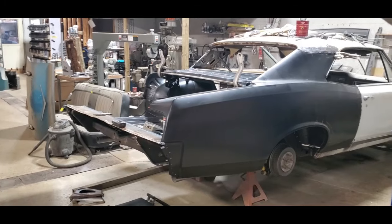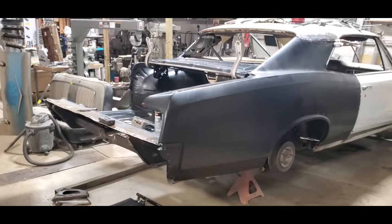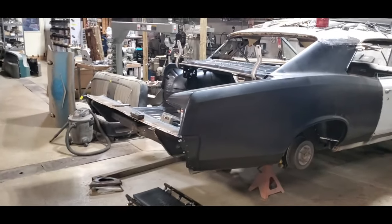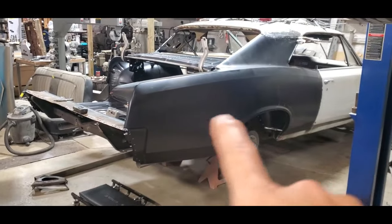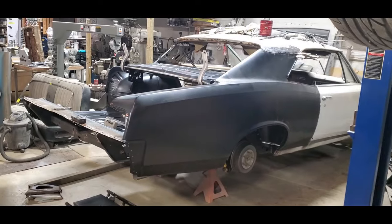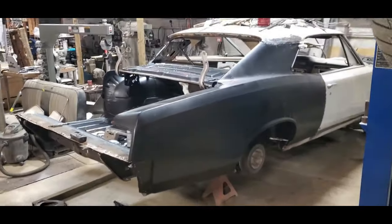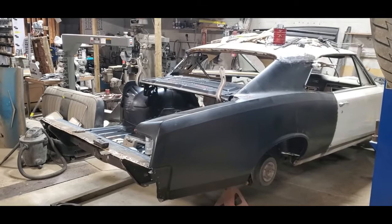You need to make sure everything's in place. As I've explained before, the heat causes the panels to start moving around a little bit. And if I was to just start welding this quarter panel on the way you see it, nothing else would ever fit. You have to put everything together, have it gapped, clamped, and then you start welding.